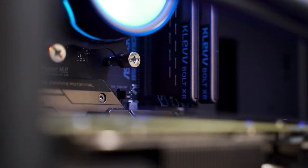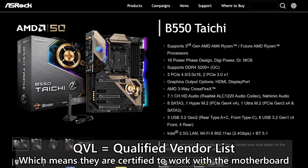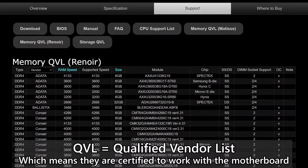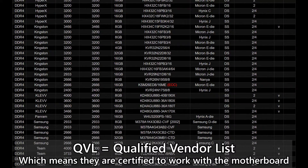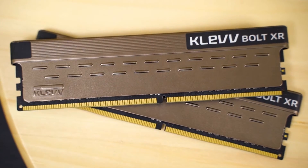That's how you get your newly bought memory kit to run at the rated speed. Before buying a new kit, even if you've seen fancy speeds and good timings, you have to make sure your motherboard supports that memory kit. The QVL list can be obtained from the product page of your motherboard — search for your motherboard model, go to the website, and check the QVL list to see whether the kit you plan to buy is listed. If it's not on the QVL list, you might get the system to post, but you likely won't be able to run the kit at rated speed without some tweaking.